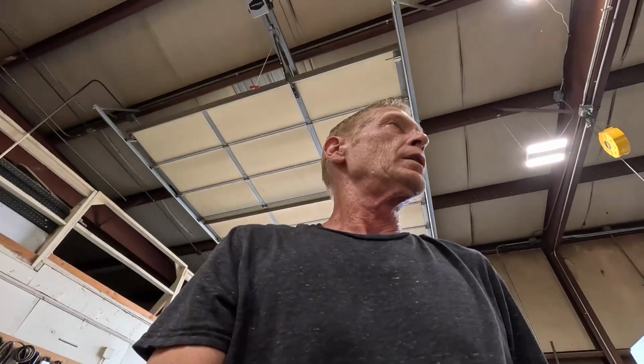I do have another truck that I'm doing complete front end overhaul, which is upper and lower ball joints. It is on a 05 or 06 Chevy. So upper control arms, lower ball joints, inner outer tie rods, pitman arm, idler arm, basically everything.